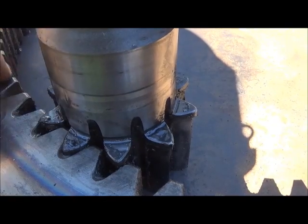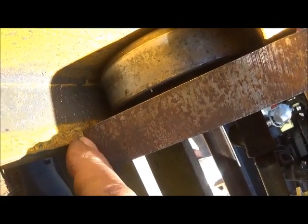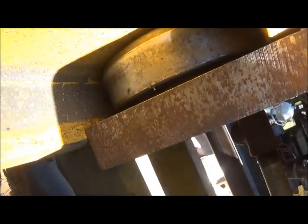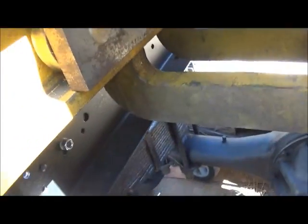The gear I'm getting is three inches wide instead of two, so we're going to machine that down and then do the bore in the center to what we need. If I can show you by turning that wheel — normally it would be down on the bottom. I'm going to machine a section of this off all the way down and off this plate so we can get it to clear. This one's the same way. That's the reason you stack all this stuff up and put it together, because we're not doing this from blueprints or on computer.